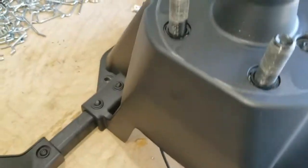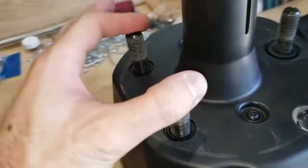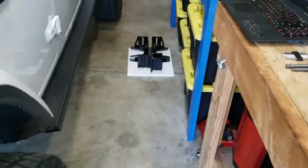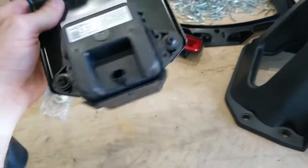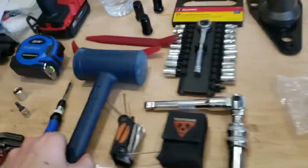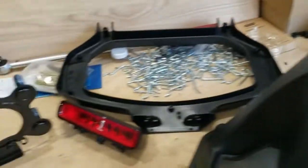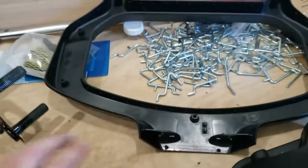Flip the assembly over and take out all the T25 bits up here, which will allow us to separate the third brake light assembly from the main spare tire mount and back out the studs that need to be transferred to the TeraFlex kit. I got the studs backed out and the T25s removed — no dead blow needed, it just popped right out. The backup camera on newer Jeeps is not part of the stud assembly. I had to use a non-marring pry bar to separate it from the back plate, but it came right off and the wiring harness separated nicely.